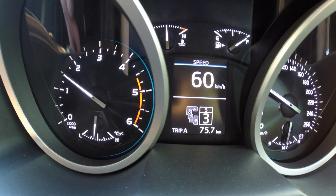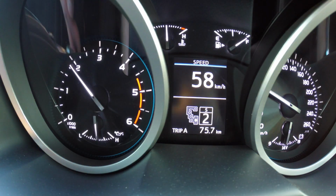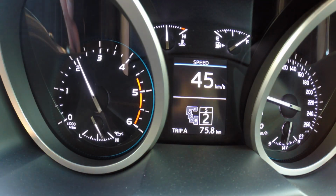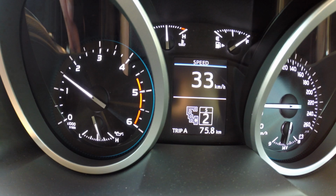Having a direct connection to that drivetrain is going to give us predictable and accurate acceleration, but it's also going to significantly improve the way in which the vehicle handles during deceleration. Now, automatic transmissions are generally known to not have very good compression braking through the engine. However, directing that driveline to be locked at low speeds and during deceleration is something that an automatic transmission doesn't normally do from factory. It's going to provide accurate and efficient deceleration compression braking through the engine.